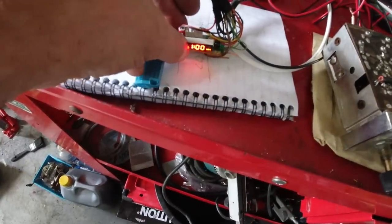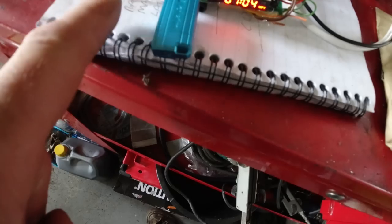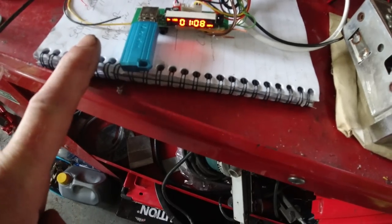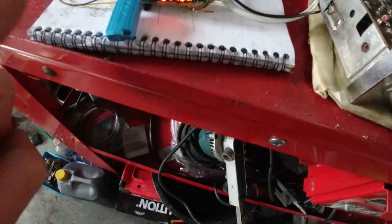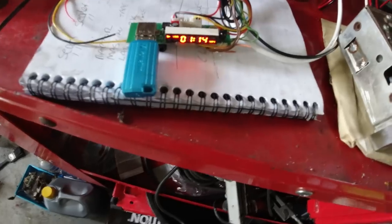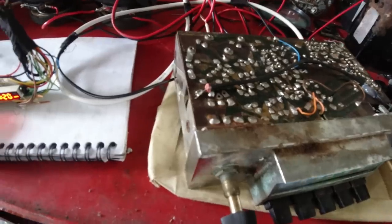It's a very tight cut but if you use thick enough ply it doesn't flex - it is a close call. I've done it before on all the other cars. This will mount behind the glove box in its own box and then you put a USB extension cable - I think you can get away with a metre after that before it loses the power rail - and then you can put your stick somewhere easy to get to, probably just in the glove box on this application.